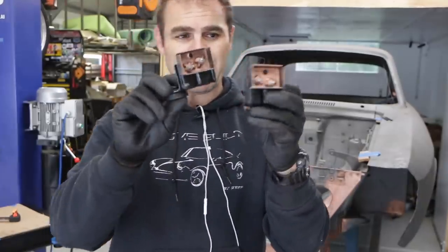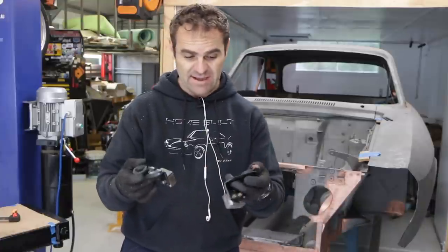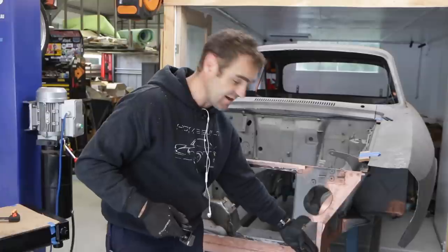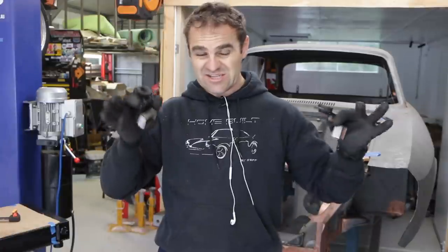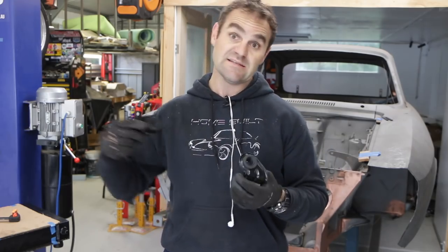What you saw me do there is I made up a couple of little mounting boxes with some captive nuts inside - this is to mount the radiator, so these are for the lower radiator mounts. I needed standoffs because these mounts do not mount straight up to this lower panel down here. I needed to space them off about 20mm. So what I'm going to do now is sit the radiator roughly in the right spot and then weld these mounts onto the car. I'll be able to bolt and unbolt these - they're just standard Subaru BRZ radiator supports - so I'll be able to replace them or do whatever, bolt on bolt off as need be in the future. Let's put this on the car.